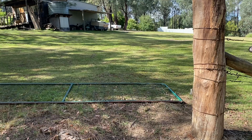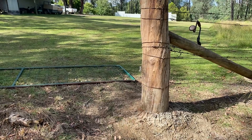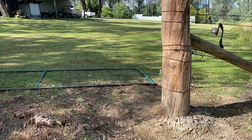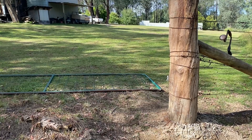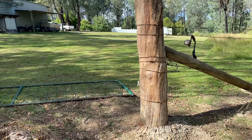There's a sort of latch thing which goes on to keep the gate shut. You can see the gate on this end is going to be sitting quite high off the ground, but as I've mentioned before, we're not putting up this gate to keep in or keep out animals — it's entirely to allow vehicles in and out. So the fact there's a gap for animals to get under is not a concern. A slight concern is the strain it might be putting on this post, but that's why it's quite a big post.